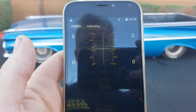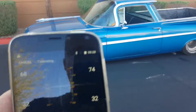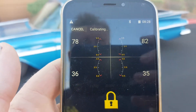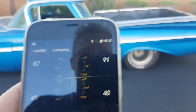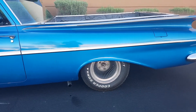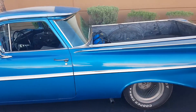It'll then go through a timer to make sure that everything is aired out, and then anywhere between 10 to 40 seconds depending on the car, it'll do a pulse on all four bags to lift the system back up again. It's just made a pulse and now it'll do multiple pulses to get you back to roughly around 70 percent of where you started. You'll see in the back that it's slowly coming up, and the same in the front.